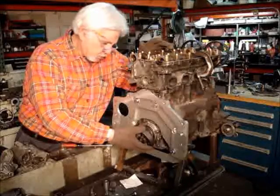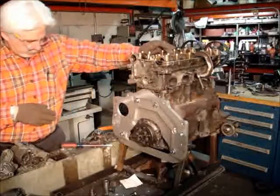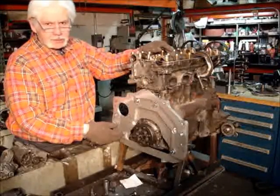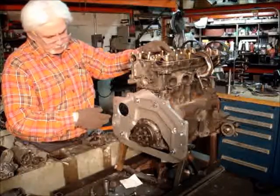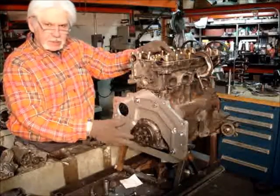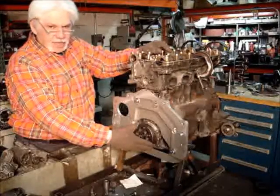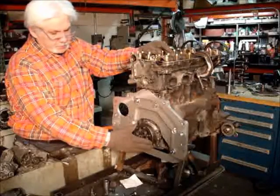Now the automatic transmission did not come with a guide pin. Manual transmissions did. The manual transmission flywheels had to be timed because they were balanced. There's no balance in these because the GM flywheel is a neutral balance. So there was really no need for the guide pin, except it's there on a manual transmission, so I put it in there and I made it loose so that I had a flat surface without the ability to cock that coupler on there in any way.